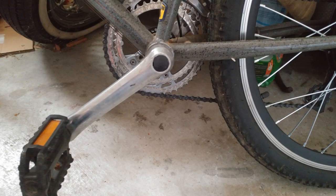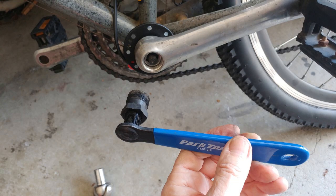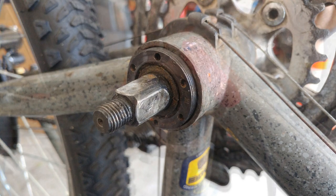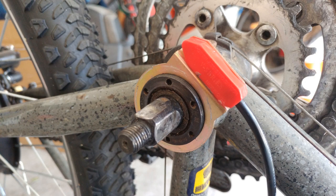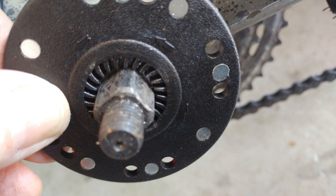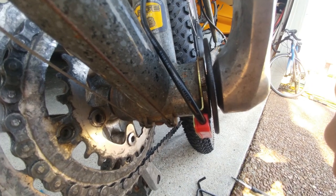Next, I decided to tackle the pedal assist, since that seemed to be giving people a lot of problems. You'll need to pull the pedal crank off, so you'll need some type of pulling tool — or maybe a large sledgehammer and crowbar. Luckily I had a crank removal tool. My crankshaft has a tapered square center, so it's a real pain to get off without the right tool. Once the crank was off, the PAS sensor fit perfectly over the bearing race. I just removed the lock ring, put the sensor on, tightened the lock ring back up, slid the magnet ring over the crankshaft, and put the pedal crank back on. Easy peasy — or so I thought.